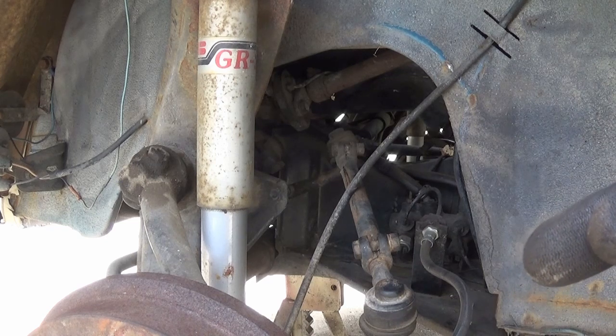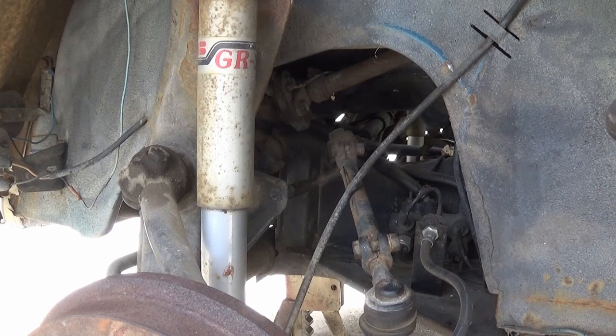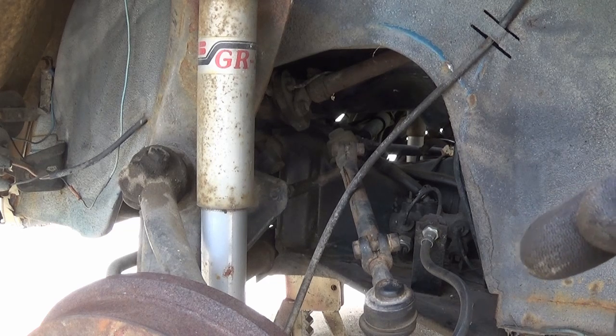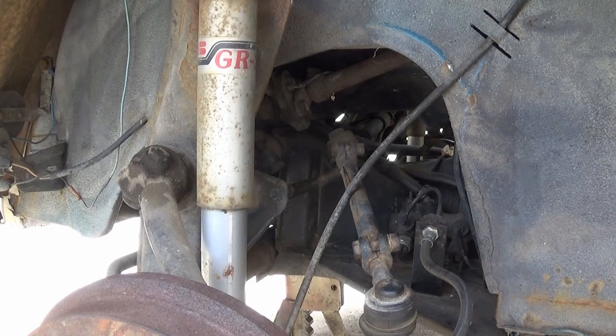These are the toe in, and the camber is all adjusted with the eccentrics. And on the link pin, they have these little spacers that are in there, and it can test your patience at times. And I don't even know, unless your king pins were perfect, if you took it to an alignment shop nowadays, I doubt if you'd find anybody that knew what to do.